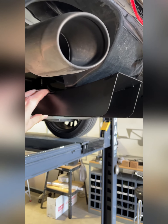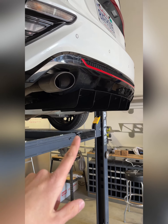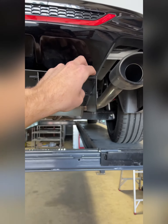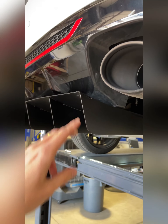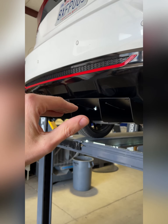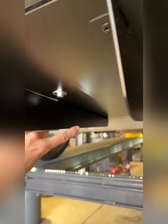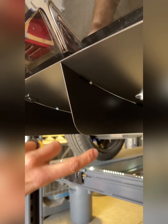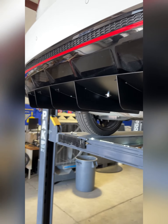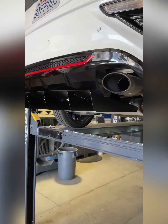That's the install for the diffuser. If you have edge trim — something to make it look nice — you can apply it to the top side here. We're applying white edge trim and we like to prep it with isopropyl alcohol first. The trim with 3M adhesive sits right on top. On the fins here, apply it along the side all the way, and use heat around the corner to form it. It helps protect your fins as well, and it looks great — we'll be taking some pictures shortly.